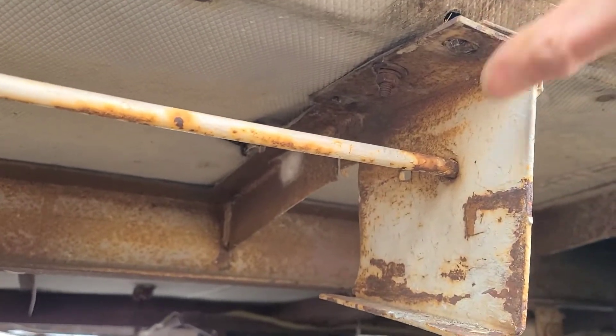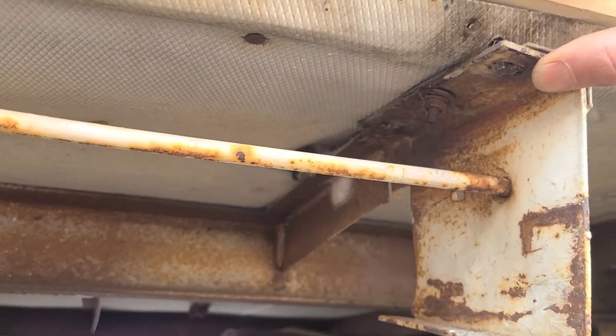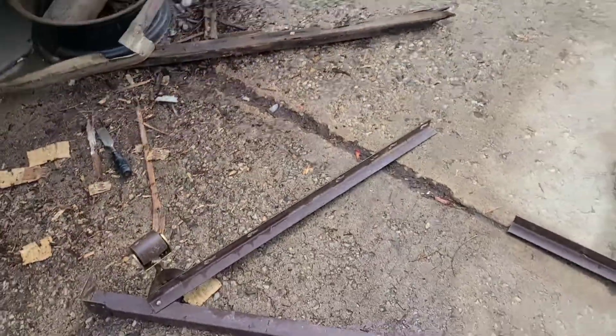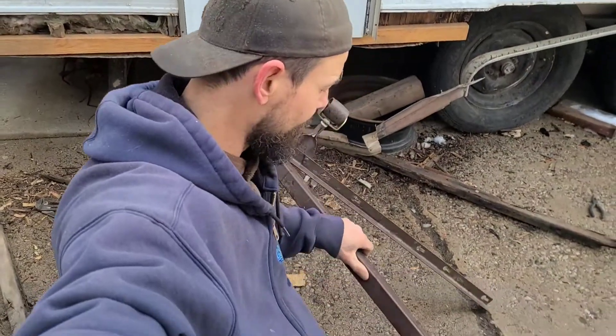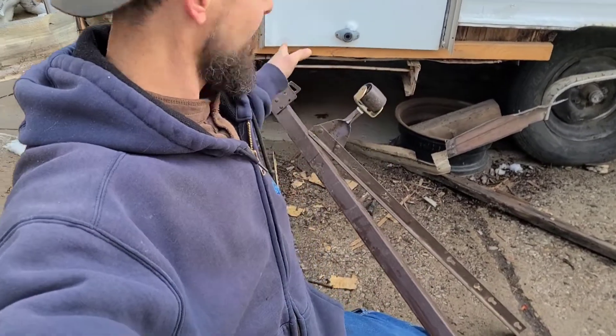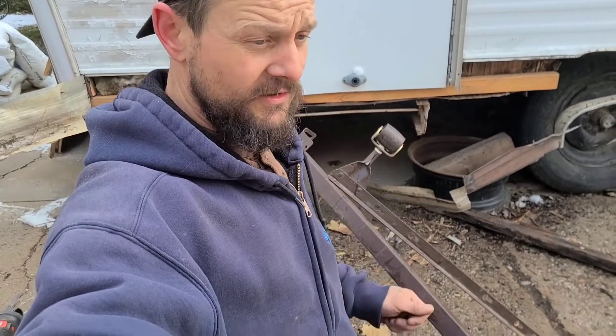I need to do the same thing here — I need to push this up. I'm not gonna be able to salvage this, but I got a plan. I saved these old bed frames just for the fact that they are perfect pieces of angle iron. To actually go buy angle iron, it can get pretty expensive for lengths. But this is pretty strong stuff. I'm gonna cut some pieces that are gonna slide right in there and attach it to the other pieces back farther where it isn't compromised. I think that's gonna support it. I'll use the car jack to lift it up and hold it all in place.